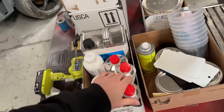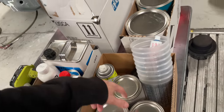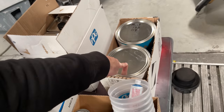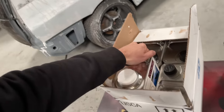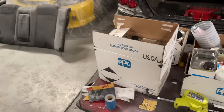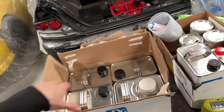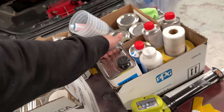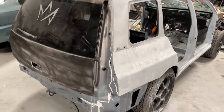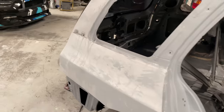So this is all the paint and everything I got for the Evo. We have two quarts of white sealer, three quarts of white, three quarts of mid coat, and a gallon of 2021 PPG Deltron clear — the really good stuff. I've always used the DC 3000, which is the quick panel clear, but since we're doing a whole car I'm curious to experiment with this. We've also got good reducer, more icing, and we're currently wet sanding it, seam-sealing the back, and doing the door jams.